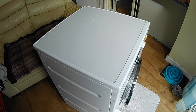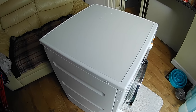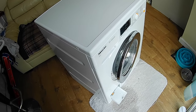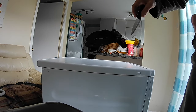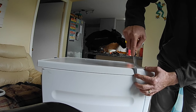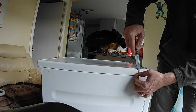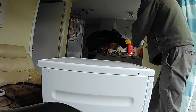Progressively with this machine, first we need to take the top off and then we need to get the side off. But to get the side off you need to take the front off first. First we need to take out these plastic pieces. I tried with a screwdriver but it started to make a mess — I've actually found the best way is a really sharp knife. Slide it under the back. Two little lugs and they just pop off really easily.